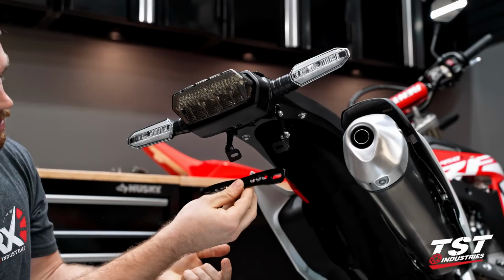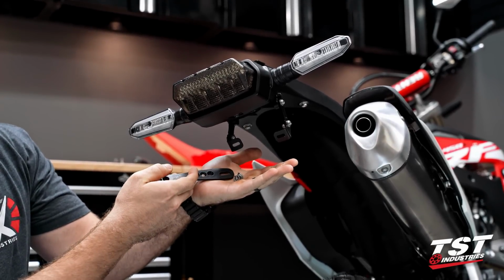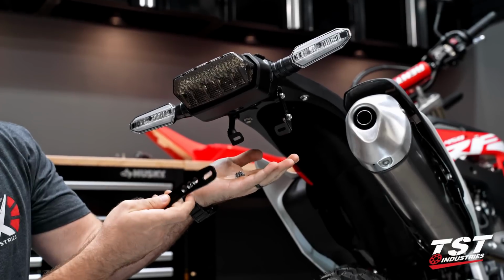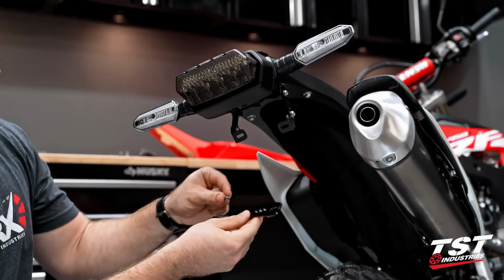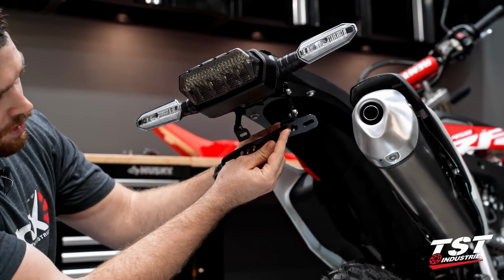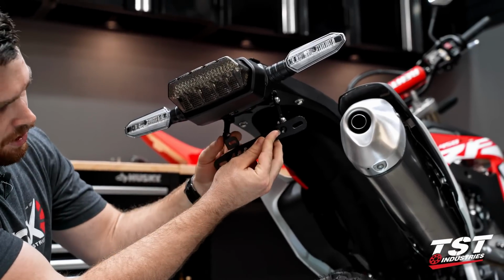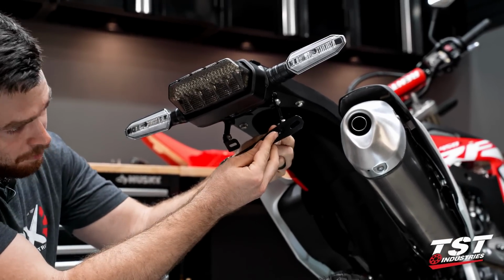So I'm gonna take my license plate bracket and my remaining hardware, which should be 2 M5 countersunks and their accepting nut features. We're gonna take one of them, drop it through the center hole of our plate bracket like so, throw it through the L bracket, and then cap it off with that matching M5 nut.